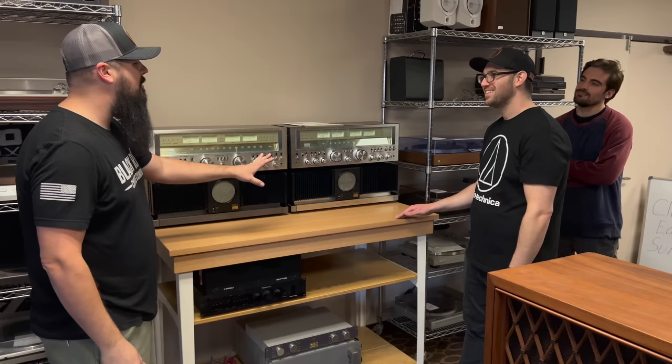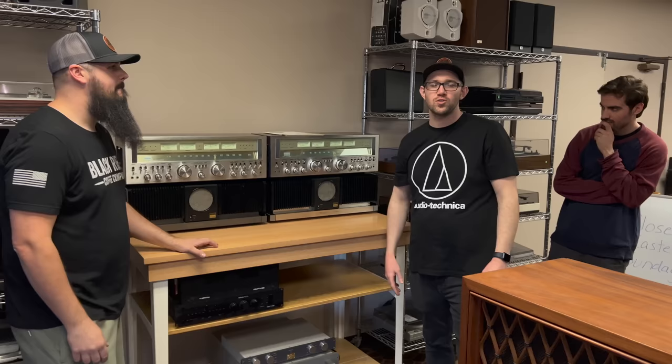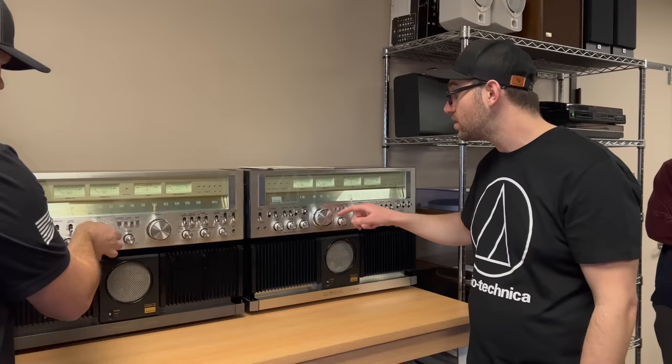Spencer, what did you see? So, the first thing I thought was, dang, that's a lot of power. Somebody out there over time, they have kids, someone cranks that volume knob, boom, speakers go. So Sansui put this little lock here where you can dial the lock inside of the volume knob to where you want it to stop. If I really push this, yes, it'll move, but now you don't want to push it beyond this lock. I can say, okay, this is the limit of my speakers. I'm safe. I'm not going to that red zone.